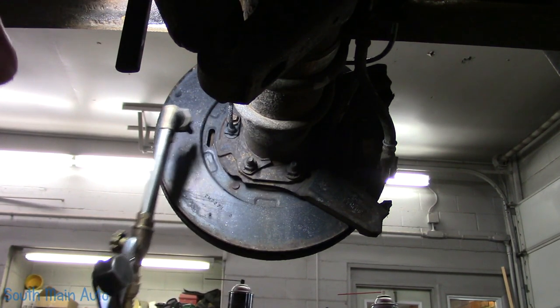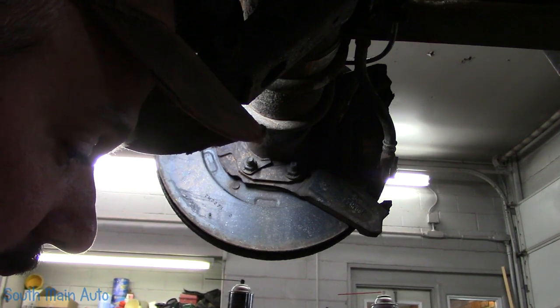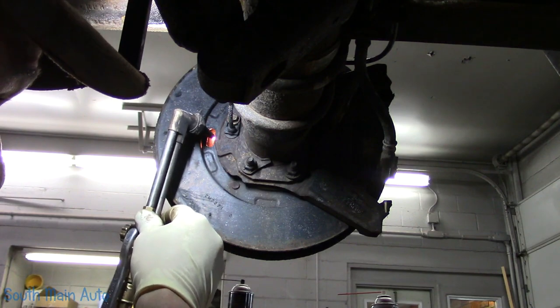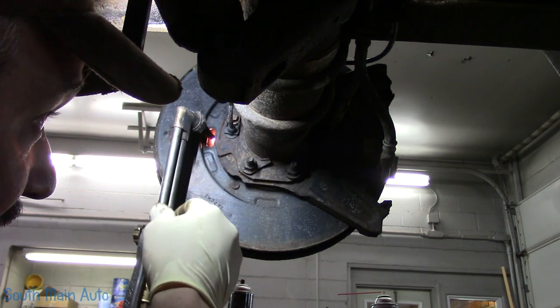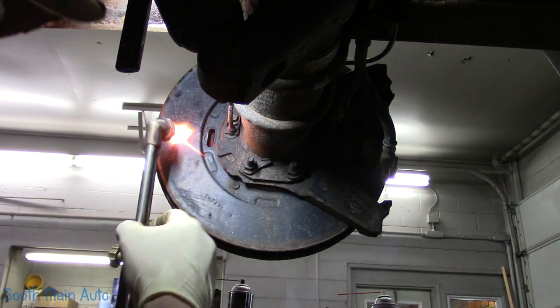You can reach in here with a torch and just cut the adjuster. I don't like doing that unless it's absolutely necessary because I don't want to ruin the axle seal. I'm just going to use a very light flame — we're just going to go in there and give her a little tickle. Now, the speed sensor is pretty close to that so be mindful. Don't go in there like an animal. We just want to put a little bit of heat on the adjuster, try to get her freed up. A little bit of heat towards the bottom of it.